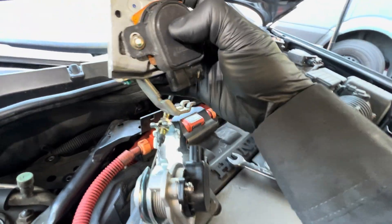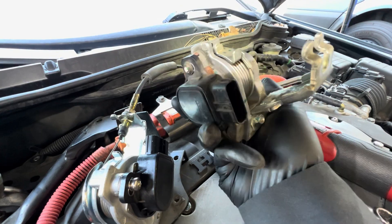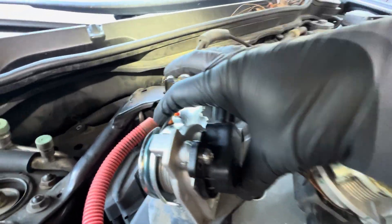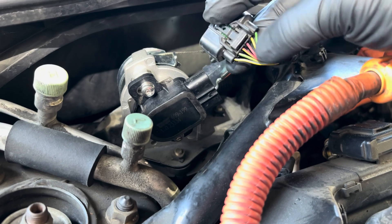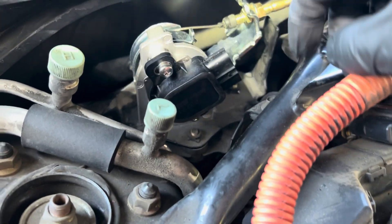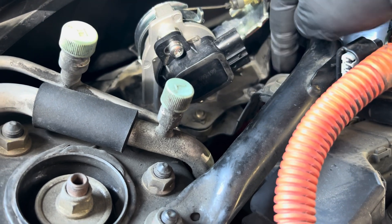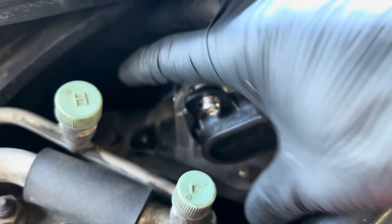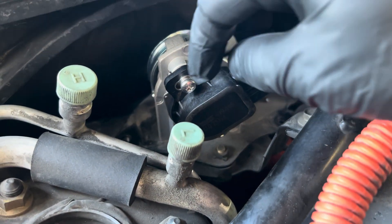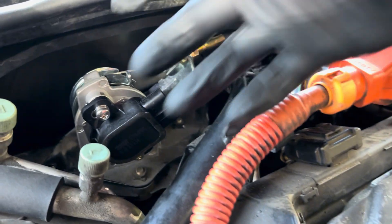For the old part, I'm not sure if this is OEM, but this is the part number — I'm not sure if it's original from Honda. Now I'm going to put the whole assembly back. Make sure you check the connector — make sure the pins inside are not corroded or bent, and make sure the wires in the back are not broken or ripped. I also found out there are two bolts here that you can use to take out the whole assembly with the big bracket, but I didn't notice them and just went the other way — it only took me about two minutes anyway.